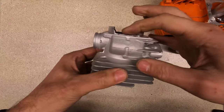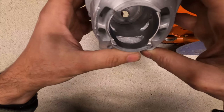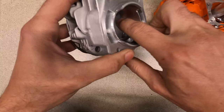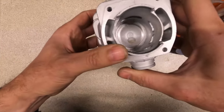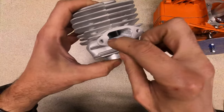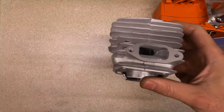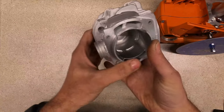You can see I've cut this out and kind of cleaned things up. I didn't do a whole lot of adjusting to the timings. I did lower the intake floor just a touch. I cleaned up the transfer ports so they all open at the same time — they were horrible; some were high, some were low. I have a plate that goes back in there, so hopefully that will be nice and smooth.